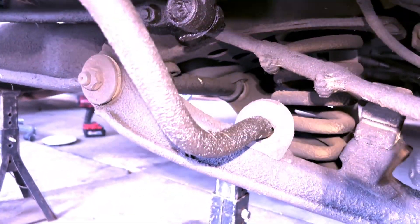After checking side to side — the ball joints, bushings, and brakes — here's one of the major concerns and the reason we haven't driven this van much. Every time we drive it, when you start braking, it pulls to the right hard — not slowly, it jerks you to the right as soon as you hit the brake. Now that we've checked the brakes and parts, we for sure need to replace the rotors and pads at bare minimum.